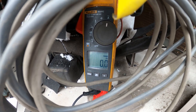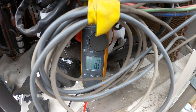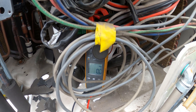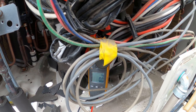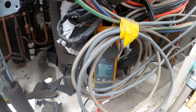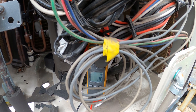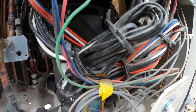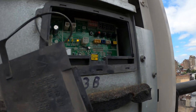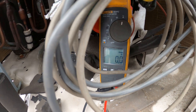We're going to reset the machine — it's the fastest way of troubleshooting — and put the meter on amps. We're going to let this thing start up and pay attention to the amp draw. If it just goes high immediately — like over 20 or 30 amps — that compressor is done, there's no reason to check the rest. When you change the compressor it's complimentary — you have to change the inverter board too, they go hand in hand. The way it's supposed to start is gradually increasing amps. If it's just immediately high amperage, it's probably locked rotor, and the machine senses it and shuts down on that CH-26 code.